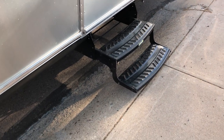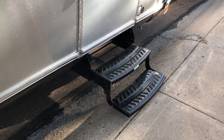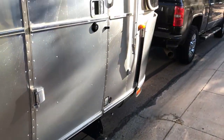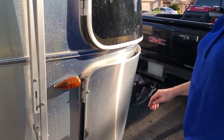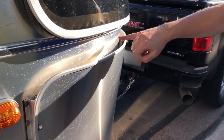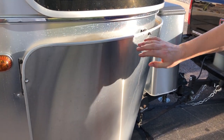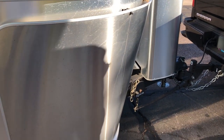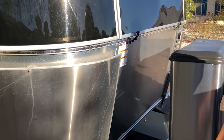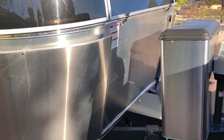These are the famous stairs that tend to strike obstacles — the newer ones are better, I think they have a lower profile. On the Airstream, these panels underneath are referred to as dead soft — the formed curved ones — and they're vulnerable to puncture. So what Airstream did is put stainless steel strike plates on the front of the Airstream. You can see they've done their job; they take quite a bit of damage from road debris. That's one of the things you notice about newer generation Airstreams versus older ones — the older ones don't have it, it's just bare metal.